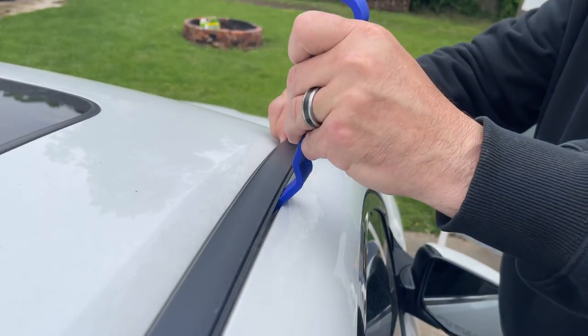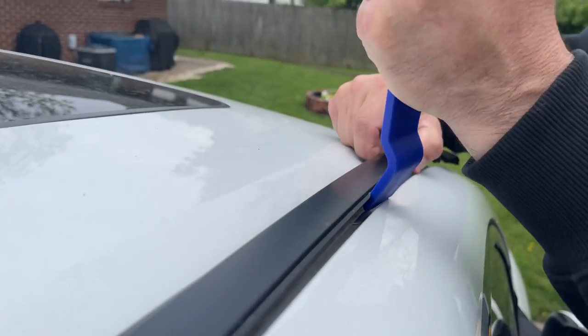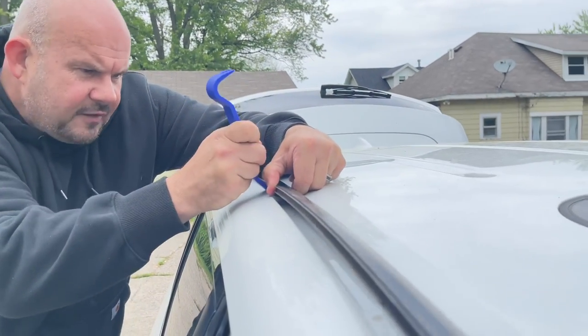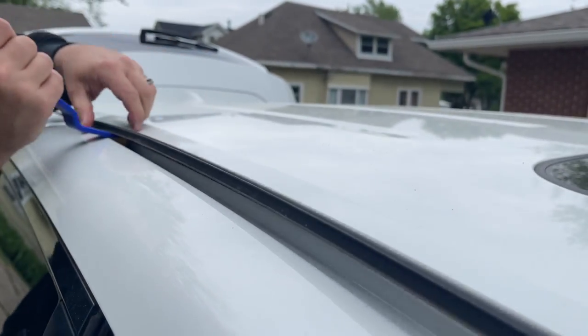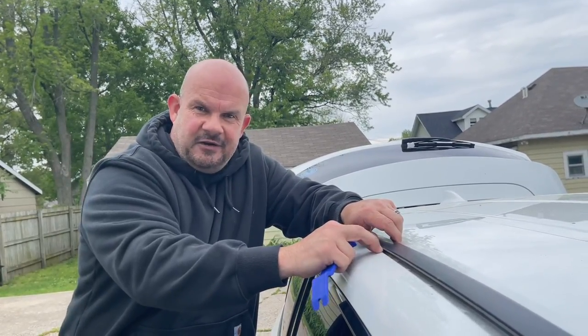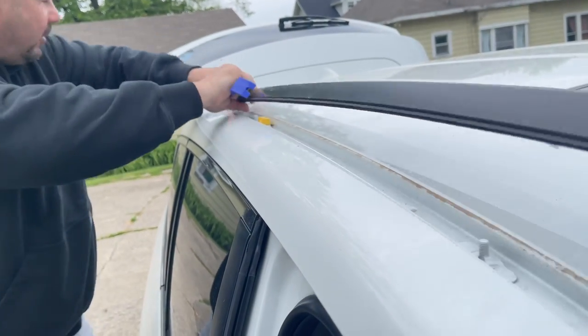This is why you don't want to be using a screwdriver — you will scratch it. You're going to go through there and see these little clips in here and you're going to slide that under. Here's one right here, and we're going to go all the way down, sliding it, finding where those rivets are. It doesn't matter whether it pops off the metal. Most of the time when I'm watching people remove, sometimes they stay with the strip and sometimes they stick down. You can pull them off — you're kind of working it all the way. They just pull off.